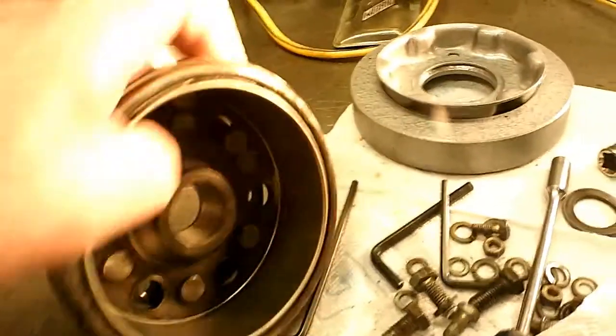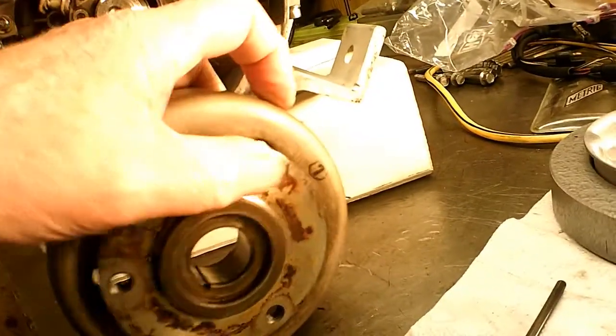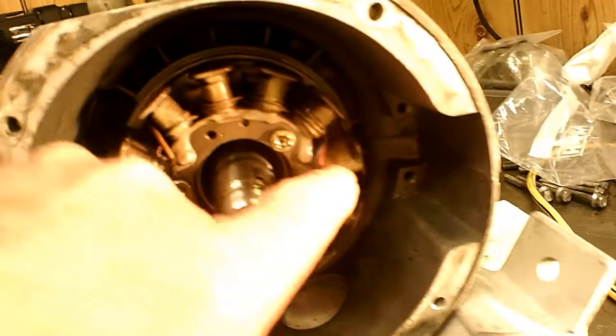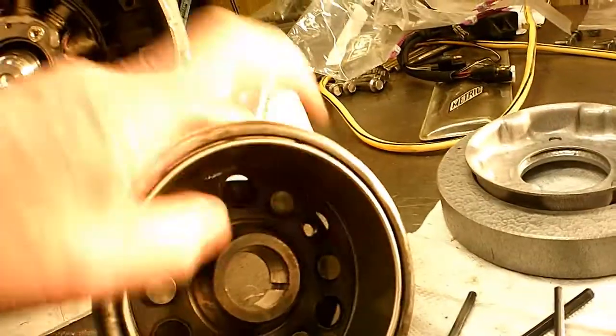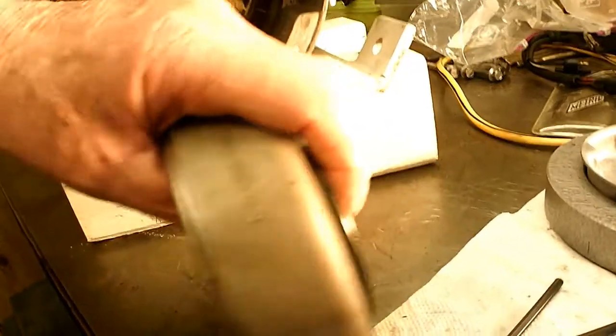The other thing I mentioned in that video was this flywheel here — you want to make real sure to keep it away from any chips or anything like that. It has very strong magnets in there, and you want to keep that real clean inside. There are holes in here that are tapped, and that's where the flywheel and the starter engagement thing all bolt on there. You don't want the bolt coming through the flywheel too far on this side, because if they did, they hit these lighting coils and tear them up. So watch that whatever you're putting on this flywheel on the front of it — the fastener you're using doesn't go too far into the front of the flywheel, or you can do damage on the inside.